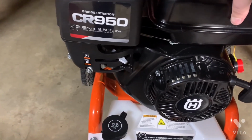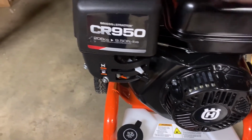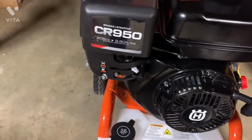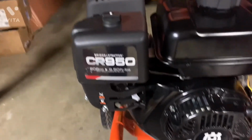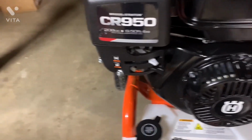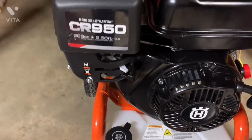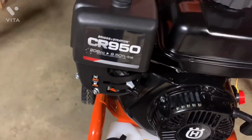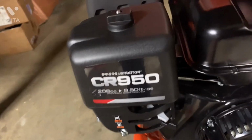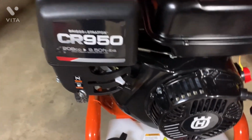They're hard to work on, they're hard to get parts for, they're real complicated, because my papa's got a push mower with a Honda engine on it, and it was real hard to work on. And besides, they make one model, I forgot the exact model number, I'll type it down in the description, but it doesn't have a removable head, so you'd have to take the sump off, take the crankshaft out, the piston, to just do a valve job, and it could be very labor intensive and expensive.